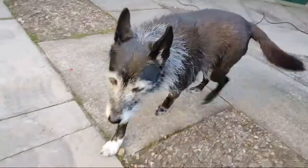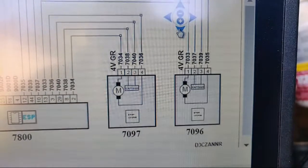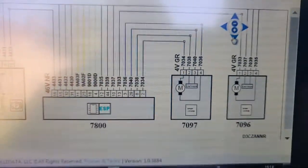The moral of this story is: don't get phased by your fault codes, and don't get phased if you can't find exact pin descriptions of what you need to find on a circuit - especially when you're doing ABS sensors and brake actuators - because you've always got a known good on the other side. Keep diag simple - it's always the basics 99.9 percent of the time. The red wire on pin three was fault 7040.